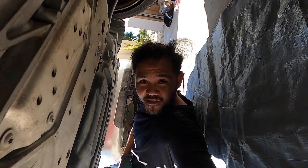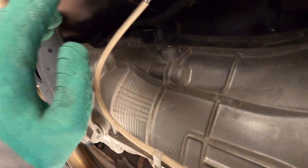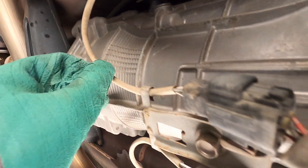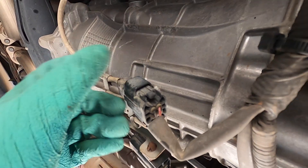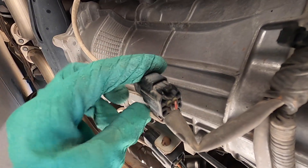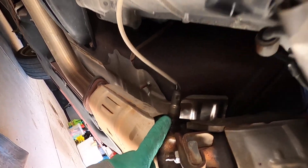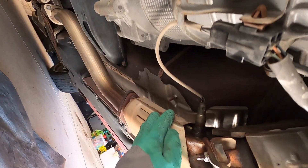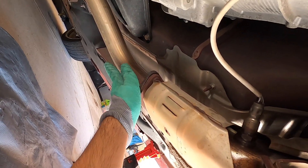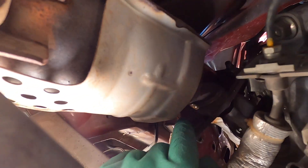This is a very nice angle here. There are the O2 sensors - there's one here and one here. You just have to disconnect this little harness - push this tab down and then pull it this way and that should be good. Then we'll go ahead and get these O2 sensors out and start on the bolts to the Y-pipe, and try to do the bolts up here.